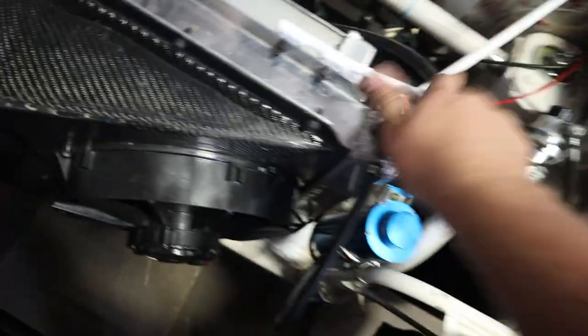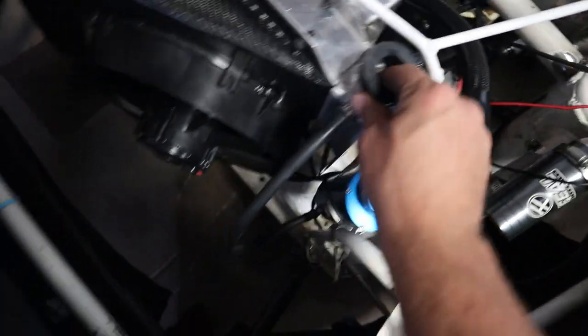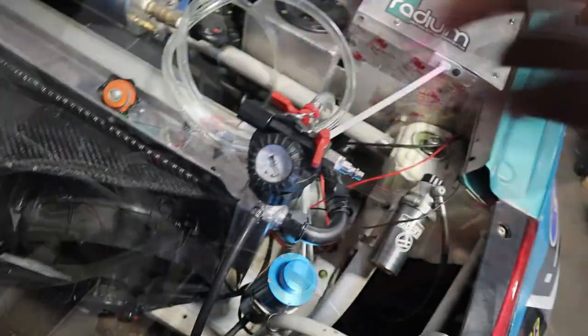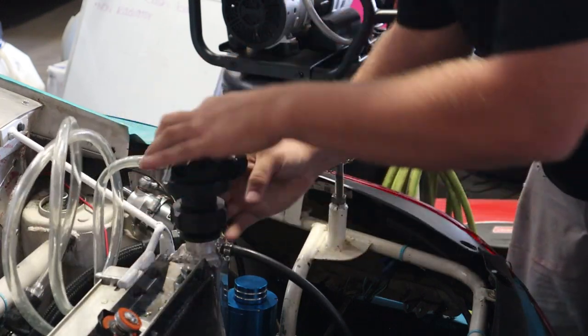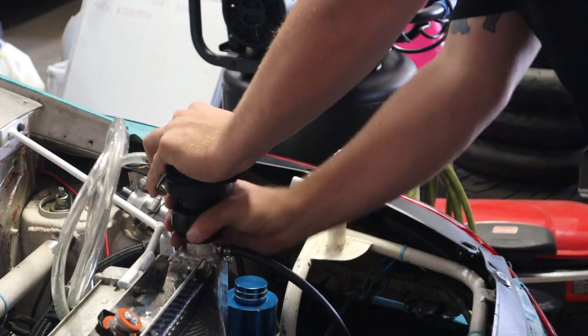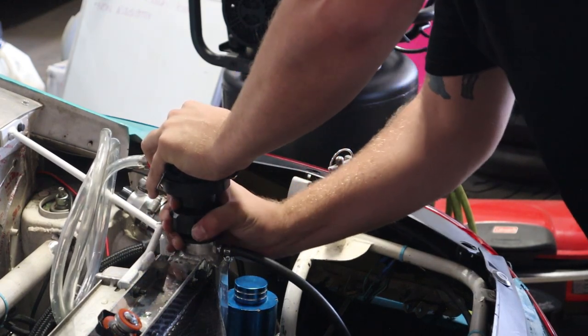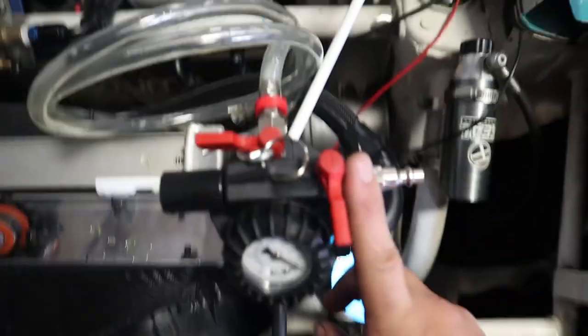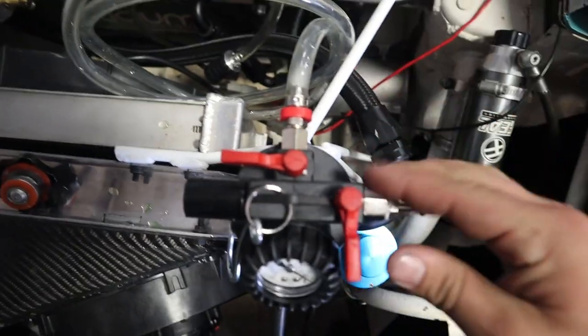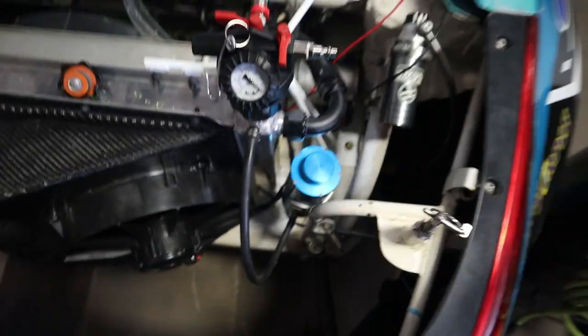Pull your radiator cap and basically these rubber pieces will sit right here — granted, this one's too big so it does not work. From there you get this piece, put the rubber grommet on the vacuum bleeder and that slides on right like so. Tighten this up and go from there. Make sure it's seated properly. You always want to push down on it just so the rubber piece doesn't fall out as you tighten it. Get it pretty much as tight as you can. Air goes in here, your water comes through here. Make sure the fittings are at a 90 degree angle from where the lines come in — this one's 90, completely shut. Let's hook up the air and go from there.